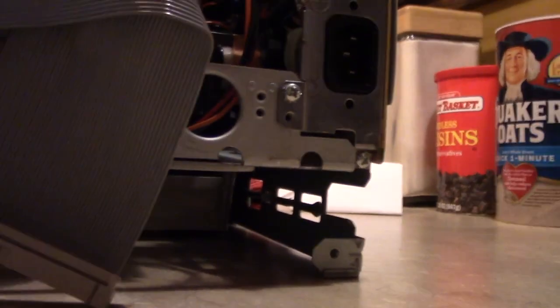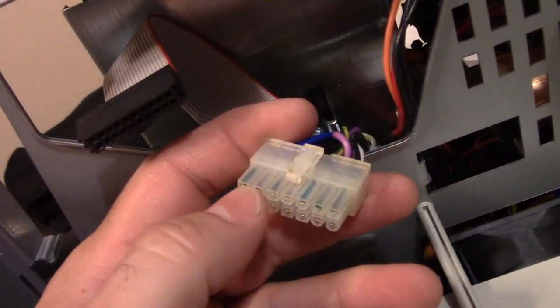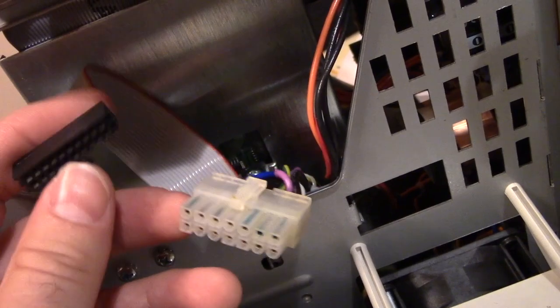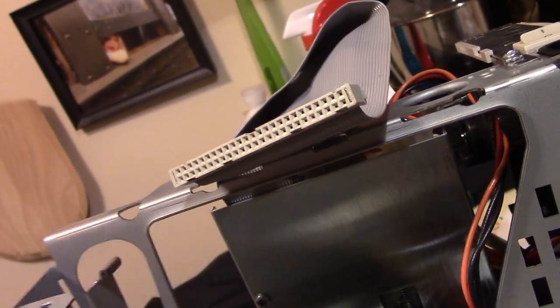Maybe it's the capacitors. Now, is it the massively corroded power connector? Maybe the machine's not getting the right voltages where it needs to be because there's some impedance caused by massive corrosion. This was caused by moisture exposure and nothing else — this was left in a damp location for a long time. That got me thinking: is that the case with the data connector on the drive? Let's take a look. Those connectors look good to me — I don't see any corrosion there. Looks clean as a whistle.